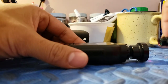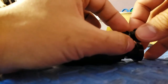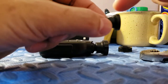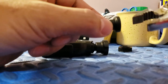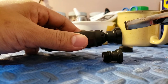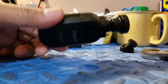The hardest part is removing the original lens, which is usually glued in. Get a plier wrapped with a piece of tape around the lens if you don't want to damage it. Then turn it forward — meaning turning in — just a tiny bit to break up the glue, then turn it out. And that's it, very easy.